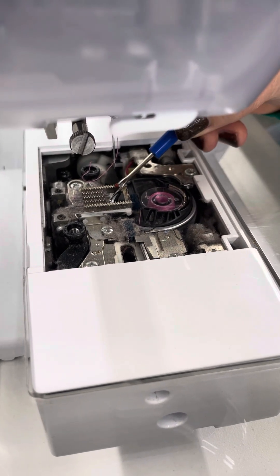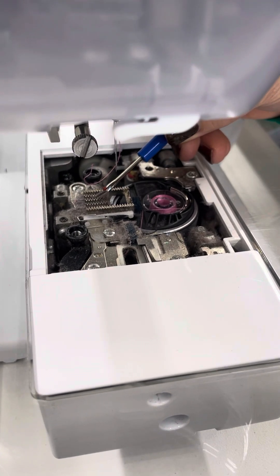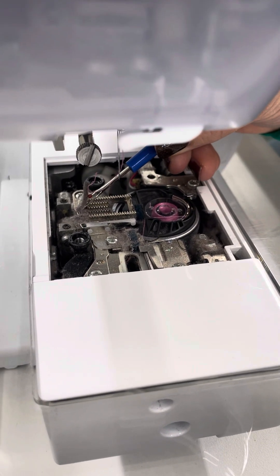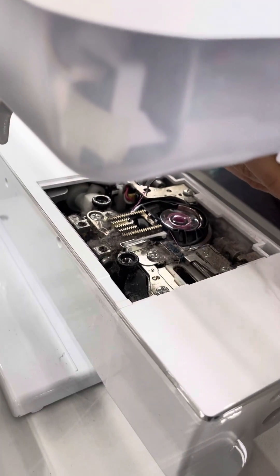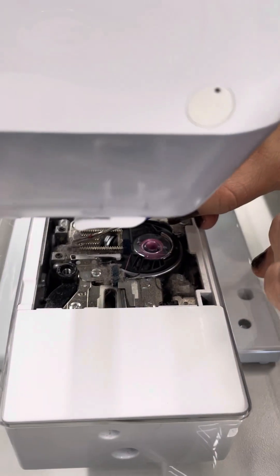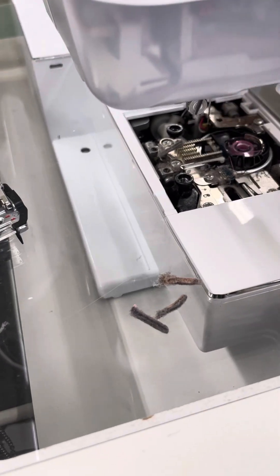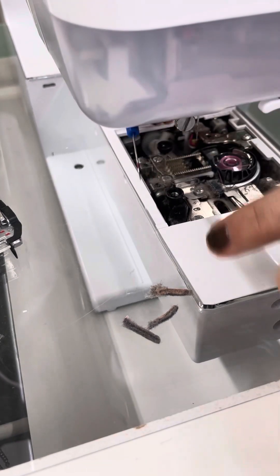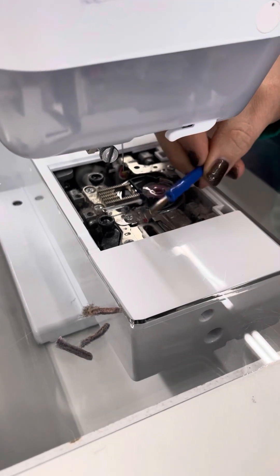Here is part of what the thread goes through, and there's a blade right in here that snips your fabric. If we look right here in the feed dogs — your feed dogs should pull your fabric through smoothly — but once you have this much lint stuck in between your feed dogs, that makes it difficult. Look at that lasagna of lint in between the feed dogs. I'm just going to take out these lasagna pieces using a small seam ripper.